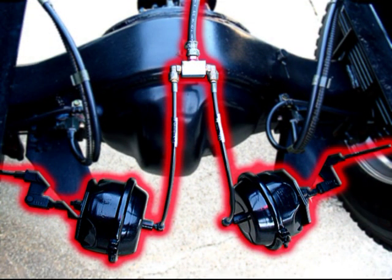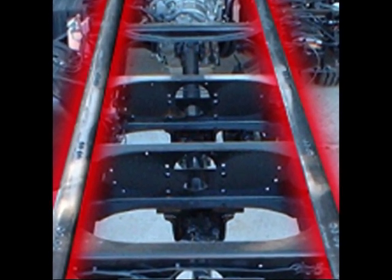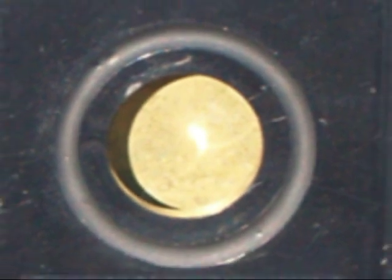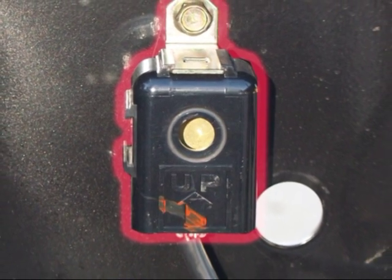A unique safety feature found just behind the rear axle is a rear wheel park brake. The rear wheel park brake locks the rear wheels in place to prevent any back-and-forth rocking motion of the truck while loading or unloading in the park position. It has become such a popular safety feature that all Nissan Diesel America inventory includes this option. From the rear of the chassis you can see the industry-leading frame strength and full ladder-style cross members. The frame has a yield strength of 51,200 psi and resistance to bending moments (RBMs) of nearly 2 million inch-pounds depending on frame length. All UD trucks come standard with a backup alarm on the passenger side frame rail, activated when the truck is in reverse to warn anyone the driver may not be able to see.